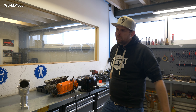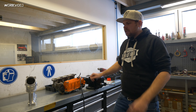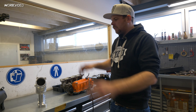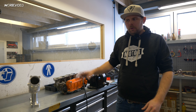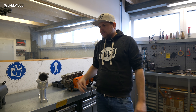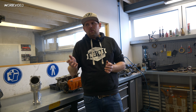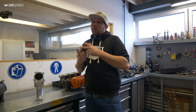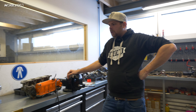When someone asks me, when does it make sense to swap out my intake manifold? I would say from around 330 horsepower upward you will see a 25–30 horsepower gain. What we also see: when customers want 330 horsepower and spend the 1200–1500 euro depending on flange design, we reach that target power faster across the rev range. So you can run more power with less boost, and less boost always means more reliability, less heat, less stress to the engine. That's also why we recommend a different intake manifold even on 300 horsepower builds.